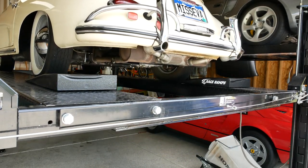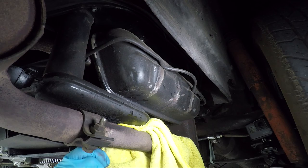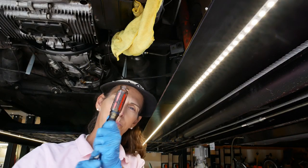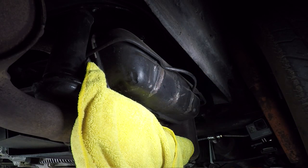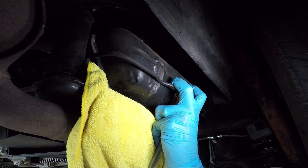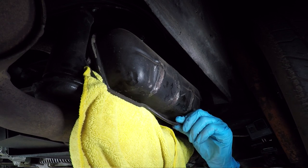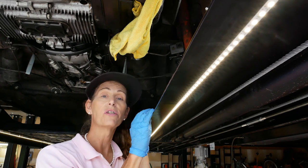The first thing we'll do is raise the car and pop off those valve covers. They're going to leak a little bit, so we'll throw a towel on the extractors so we don't get oil all over everything. To get a valve cover off, we use our tool to pry the bailing wire bail cover off and drop it down — prying it out and down to come off that notch, then dropping it all the way. That bail wire is all that's holding the valve cover on, so now we just work the valve cover off.